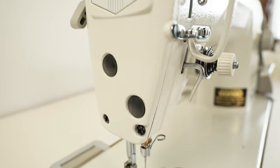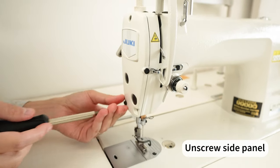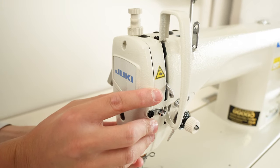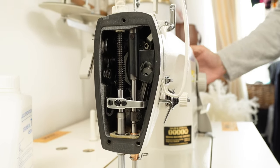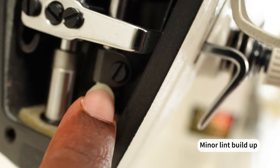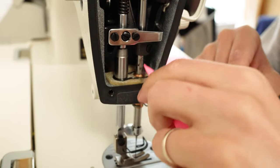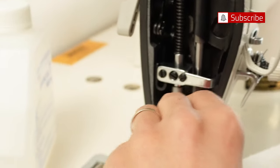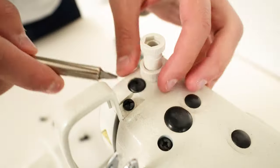I'm going to open up the side panel first. I'm being guided by an article I saw online — I'll leave the link below. My husband is helping me unscrew the three screws. After removing those three screws we're able to open up the side panel, and this is what it looks like. There wasn't a lot of dirt in this area, but there was a little buildup of lint sitting underneath the bar, and we went in to scrape that out using some paper or any tool that can get all the dust and gunk out.